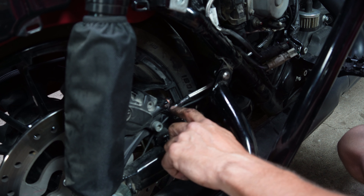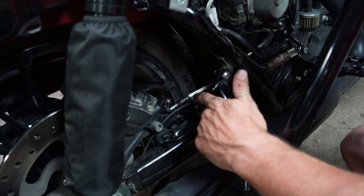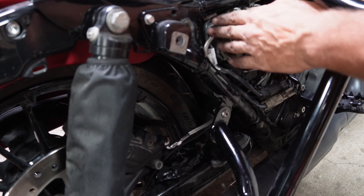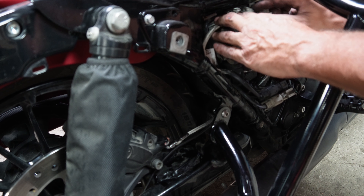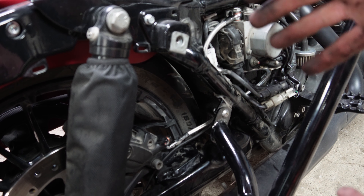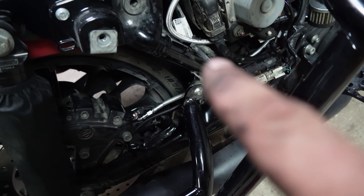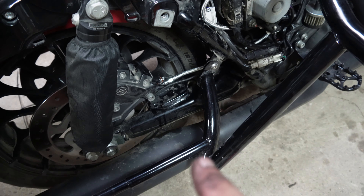So what I had to do — we're running this straight out. It should not hit this bar, should not get pinched in between here. It's running underneath the ABS, back up and around. I had to flip the top 180 degrees to get it to want to stay here instead of flopping out into the cover. Now I can get everything tight here. Sorry, this is a quick and dirty job — I don't have torque specs for you. There is the line around there. You can see it run, make a loop, and come back around up to the top. Everything is tight. Now it's time to get this bled.